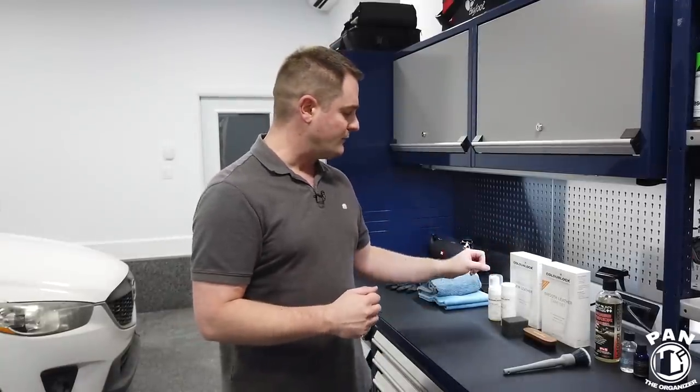You want to protect the steering wheel against cracking, fading, discoloration, dye transfer, and friction damage — the same applies for leather seats. Some of you might not know this, but the pH level of leather for automotive use is roughly 4.5 to 5, so you want to use a cleaner that's appropriate — like the one we have today, which is roughly pH 5. Contrary to many alkaline degreasers and APCs, you want to be careful not to use those too often on leather, as you could change the pH and damage your leather surfaces. The majority of leather surfaces today are coated leather, meaning there's a form of clear coat on top.